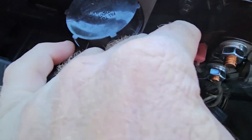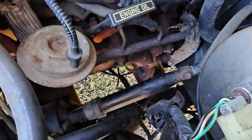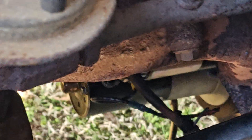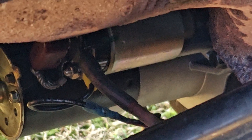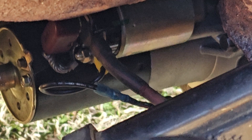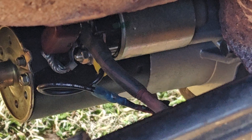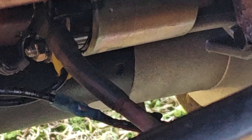Here's your little red wire — that one, when you turn the ignition key, pulls power and goes down to the starter. Big red wire on the top post on the starter. This little small wire that I just showed you goes to a little nut right there. I don't have one of the trucks to show you, but there you go.